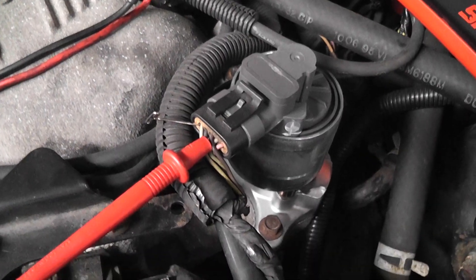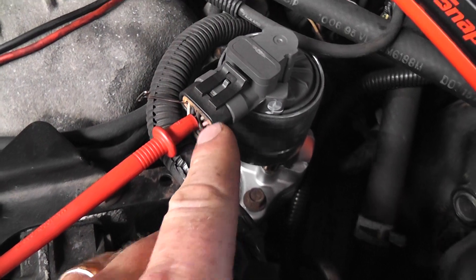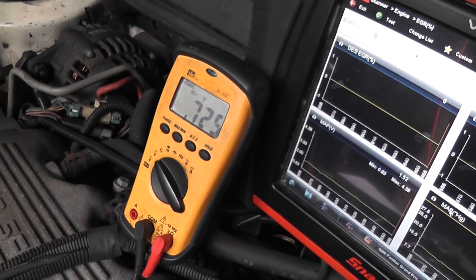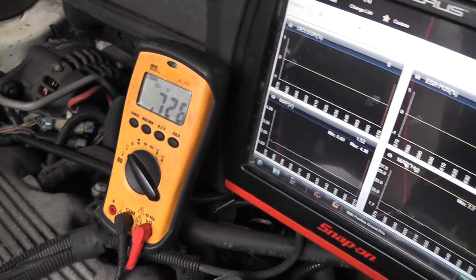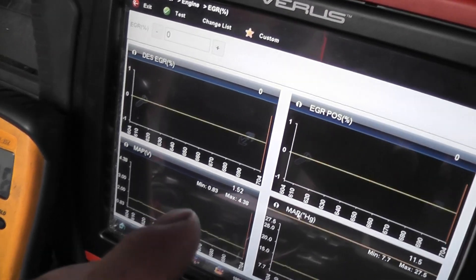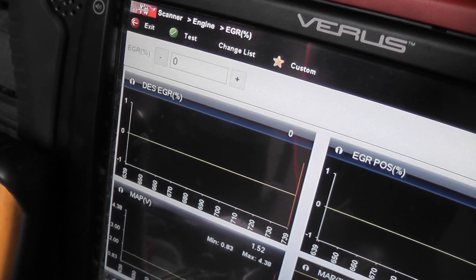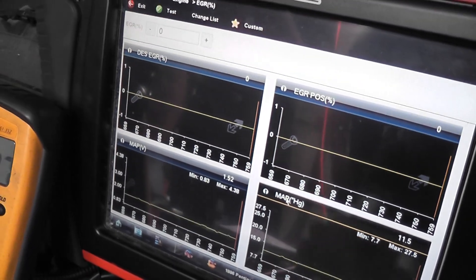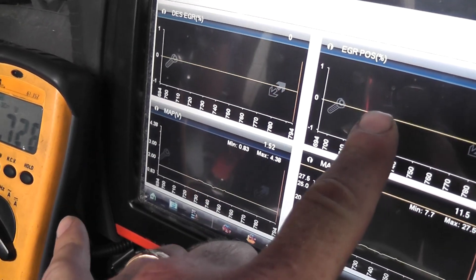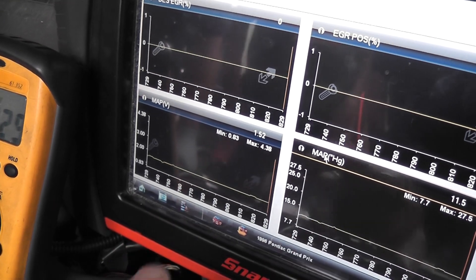A couple of different connections I wanted to show. I'm on the signal wire with a volt meter, which is the center wire — a brown wire connected with my volt meter. I have my volt meter set up at 0.725 of a volt. Pulling up the scanner data, it's not giving me EVP voltage on this one, but it is giving me EGR position percentage and the desired value the computer wants it at. This percentage is based off of that voltage. We're going to watch both of them and also watch our MAP sensor to see how much of a MAP voltage change we get when we do the test.